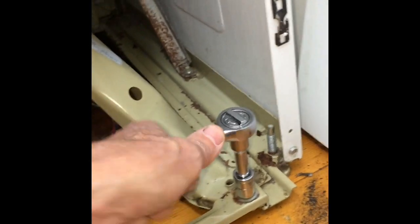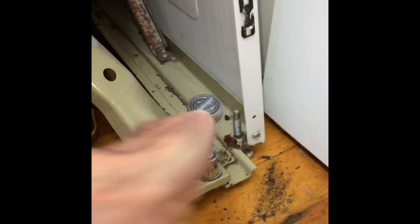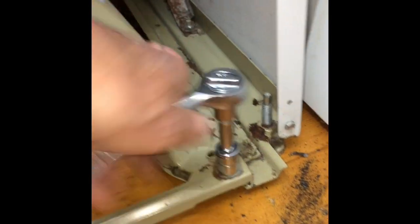Now this is underneath the machine with the panel removed. I've also already removed the motor. I'm going to remove these two half-inch bolts — they're what's holding the washer assembly into the laundry center. Once we remove those, we can actually slide the whole washing chassis out so we can access all the washer components pretty easily.